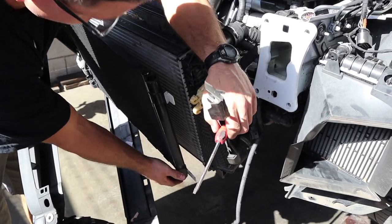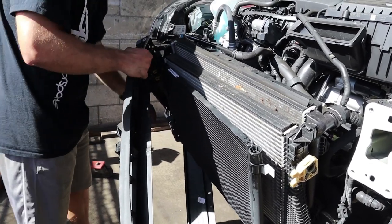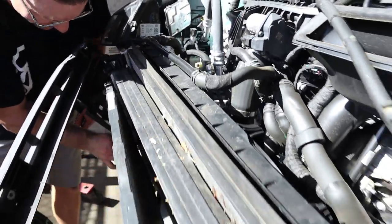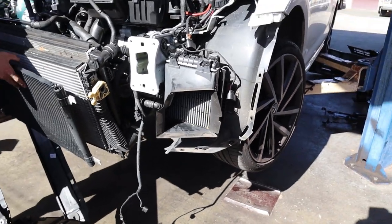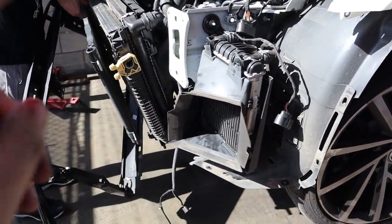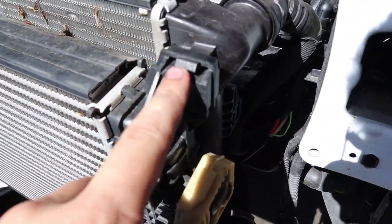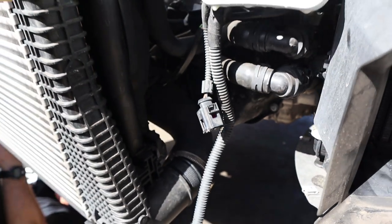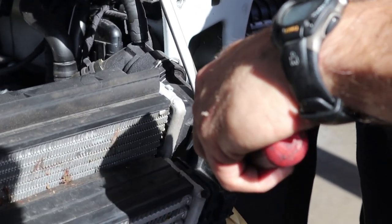So it's a condenser, not a transmission cooler - that's a little disappointing. I was really hoping it was the biggest stock transmission cooler ever. Post in the comments if you know what those inlet vents on both sides are cooling - brakes or transmission? We disconnected the hoses, then we're picking these clips off and that should pop it right off. You might have a little bit of resistance. Got this side off already so I'm going to start holding it.